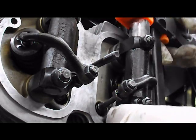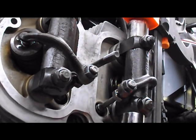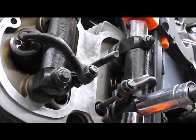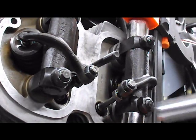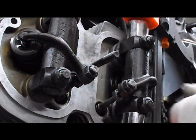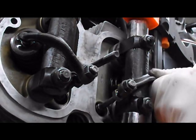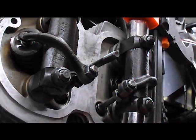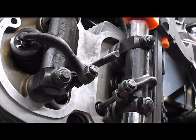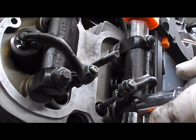A little bit more, a little snugger than I would like. So now we're going to go back. Loosen the bottom again. You're going to take your hammer, give the rocker a gentle little tap. See, now we have some clearance back again. You might do this a dozen times before you get it to where you want it. Just the way it is.